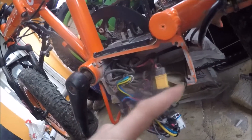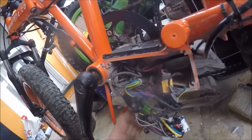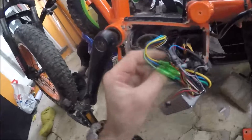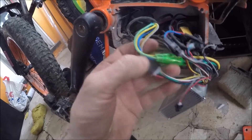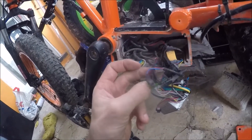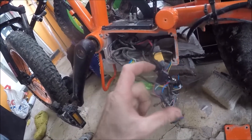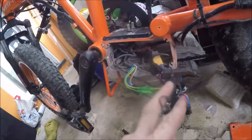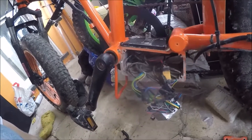In terms of wiring, we've got a fat black and red wire that goes straight to the battery, then generally three big wires that go to your hub motor, as well as a block connector of six wires which also go to the back hub. Then you have two for lights, two for brake sensors, one for a hall sensor on the crank, and one going to your dash - the controller on the handlebars.